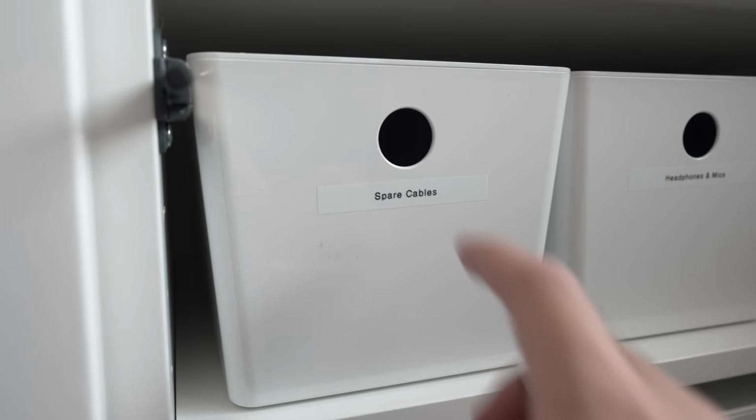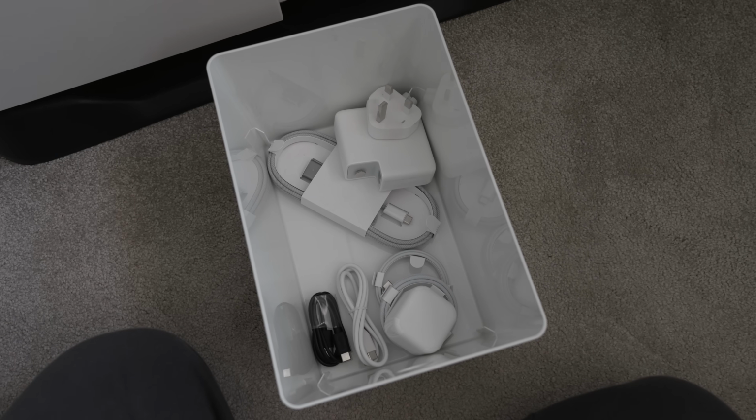So while it might be irritating, you need to isolate and test each of these. Use different cables, different sockets, different charging bricks, and give your phone's Lightning port a clean if it's dirty. I'd recommend using a clean, dry toothbrush for this and see if any of these fix the problem.